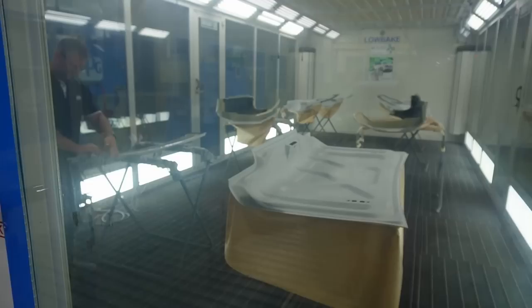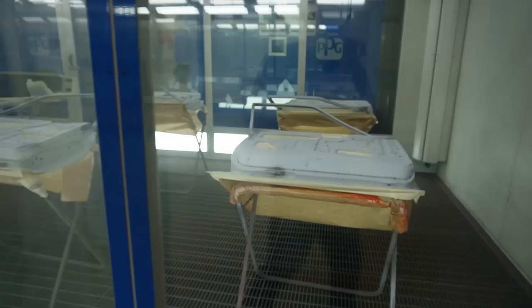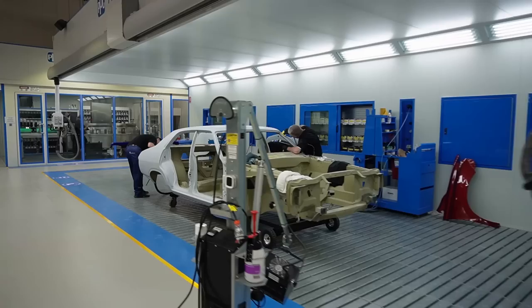I mean, a lot of that's to do with your product development here as well, isn't it? Yeah, very much so. We always like to try our stuff that might not necessarily get used in the custom world, bring in some of the stuff that we trial from the smash repair world into custom, like the wet on wet primer we're about to use for all the insides to give us a good ground coat. They're all back masked to keep it off the outside. So we'll get that wet on, and then we're out here doing the jambs.